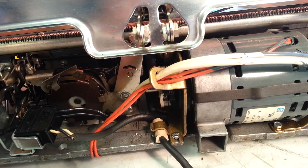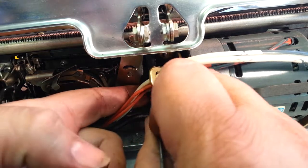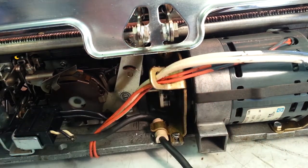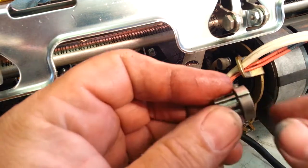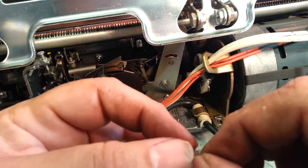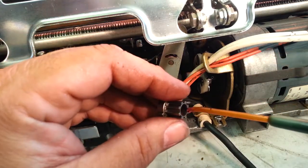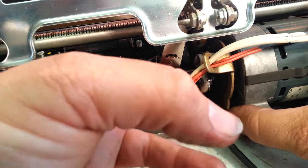First thing to go back on is the first washer. So that goes on. Manipulate it on. It's very tight. It goes up against the clutch all the way. And next thing is the pulley. Or, yeah, I guess it's motor pulley. We need to put the bushing inside. So we have the one that came out of there. It still looks pretty good. So we're going to stick this in there. And a little bit of red oil in that. And that's going to go on the shaft. Just like that. And then when you get...